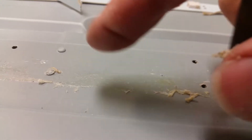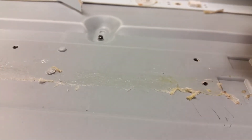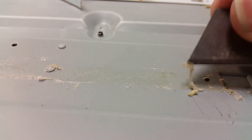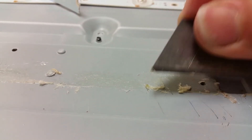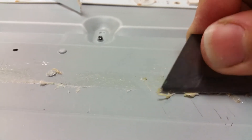If you want to do a good job replacing the strip, you've got to make sure that this surface is clean and flat for the new strip, otherwise it won't do good heat dissipation and the new strips will fail soon. I swear to you, you are not going to make money if you have to do that for seven strips.